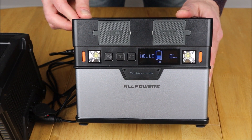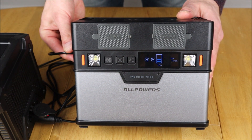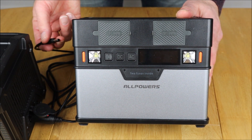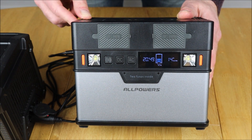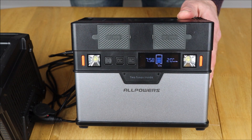Taking that out and putting it in again — it'll probably cap itself once it's settled. And as you can see it's gone to seven watts, which significantly increases charging time. The only way I've found to combat this is to take out the power and leave it for three seconds so the display goes off, then give it a few more seconds, and plug it back in. It should then start charging properly again and go back up to where it was. As you can see it's done just that — it's gone back up and settled around 20 watts. Very odd behavior.